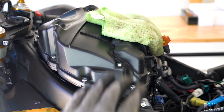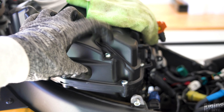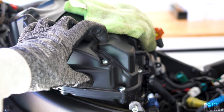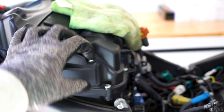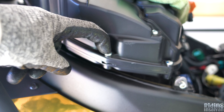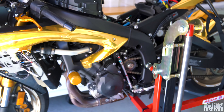Now onto the bike itself. I still need to remove this — these are Japanese screws so you have to use a JIS head screwdriver. I ordered a JIS bit that came in. I've never used one before — I used normal screwdrivers and really messed up the threads. This time I actually have the JIS one so we can do it correctly.